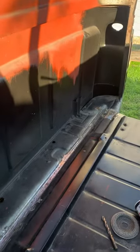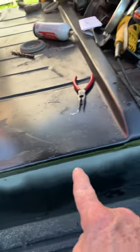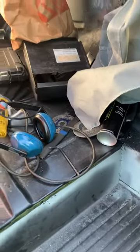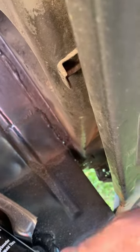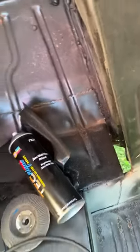As you can see now it's all nice and pretty in there — it's welded in. I still have to come down here on this seam across here, either spot weld or just run a nice little channel in there, cut that in, and weld. At that point the floor will be completely finished. Right down in here, see this? All that still has to be cut in — meaning fit it in there, weld it in, then primed and painted and all that, because that still has to be done.